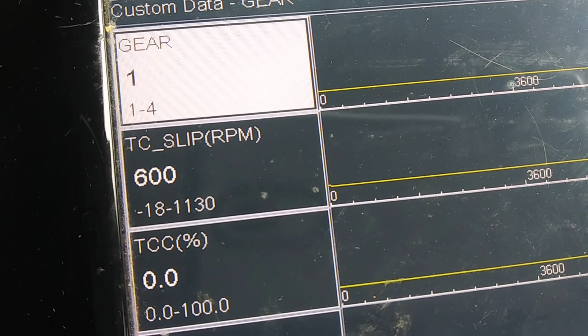on. So what was happening is when this thing went into second gear, as soon as it hit second, that TCC slip went to 0. Even though the solenoid stayed off, the clutch was on. And when it did that, it gives you the early TCC apply, the chuggy, luggy kind of sensation, which you really don't want to feel. At least you don't want to feel it in an 06 Ford F150 when you're driving it anyway. So that's what was going on.